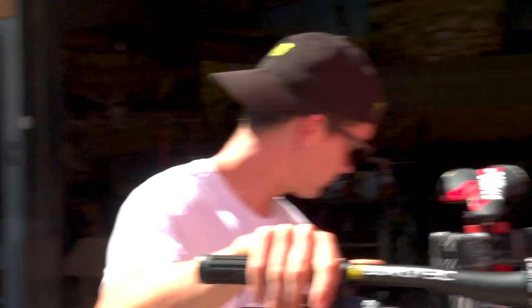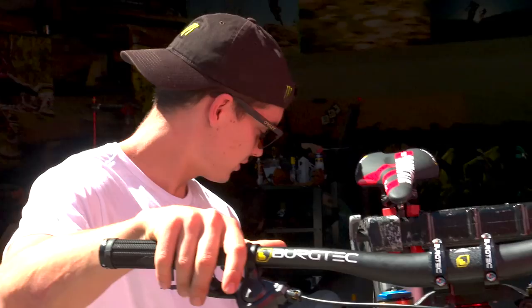And on the uphill, there's always your thumb to push it up. So undo a little bit. Yeah, you want your downhill. So you make the downhill better, because we are riding downhill. Like XC, they want when they go up to be perfect maybe, and down it's like fine. I don't know, maybe not. The enduro derailleurs are just better made. It's all the structure and having a longer cage that helps to have better shifting.